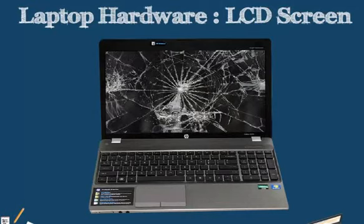Both the inverter and the LCD screen may be able to be replaced depending on your laptop make and model. You may be able to replace them separately. They may come bundled together, or you may have to replace everything above the hinge on your laptop. Again, it really just depends on your make and model. So you want to make sure you check your actual laptop disassembly guide. You take it apart depending on the manufacturer's specifications, look at a video or two if you need to, and then order the exact same part. Get it replaced and get your laptop up and running again.